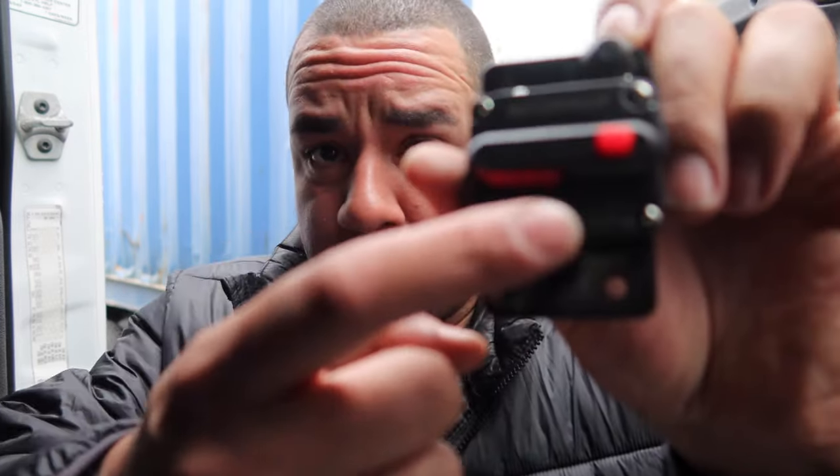A trick I learned: for the amp rating you need, take the wattage and remove a zero. This one is 300 amp, which means it works for a 3000-watt inverter. I have a 1500-watt inverter so I needed at least a 150-amp circuit breaker. This one is okay because I only use one appliance at a time. Whenever I'm in my truck I don't leave it on unless I'm going home for a day or two with a full refrigerator — just don't use the refrigerator and microwave at the same time.